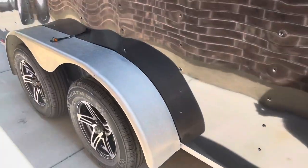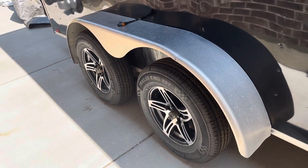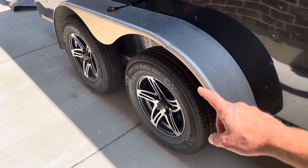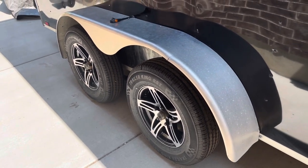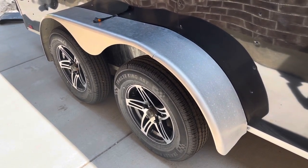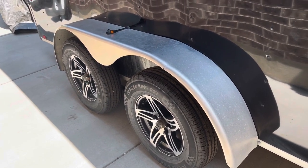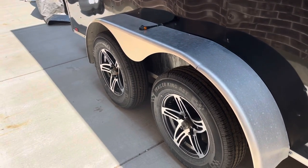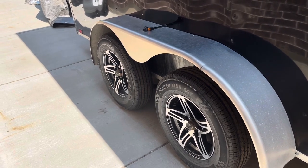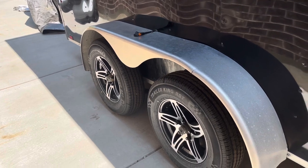The trailer handled great — there were no vibrations, the wheels look great. One thing I need to remember: with all aluminum wheels when you put them on a new vehicle or trailer, you need to re-torque them after about 50 to 100 miles because they can work themselves loose. I'll torque them down to about 100 foot-pounds. Thanks for watching — check out the links in the description for these wheels and tires, leave a comment, hit that thumbs up, and subscribe to the channel.